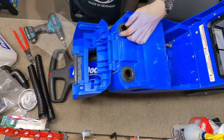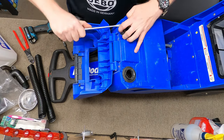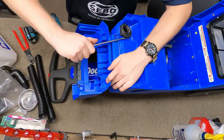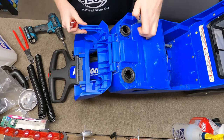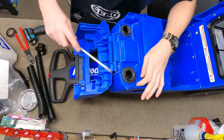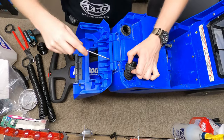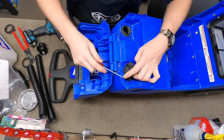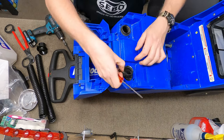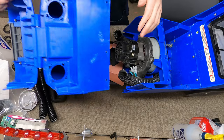We have hoses to deal with. These are going to come apart — you just got to be a savage about it. Then we'll just unclip like so. Don't worry about these, you're changing them out. The new part has the clips on them; one side is A, one side is B. You don't need to be gentle with anything — it's a Rug Doctor. But there are these clamps here and they'll come apart like so.